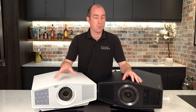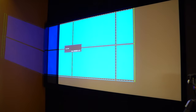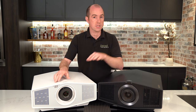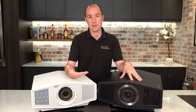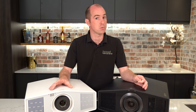One of the real big differences between these projectors is the 5000ES's lack of a motorized lens. This is a massive difference. When installing a projector you always try to get it centered on the screen but that's not always possible, so you lens-shift the image up, down, left, or right. On the 5000ES you have to do that manually via dials under a cover. Moving them by hand has the potential to shift the whole projector position, whereas the 7000ES — like most competitors — has a motorized lens controlled by remote. By removing it on the 5000ES, Sony has clearly done so to bring the price point down.